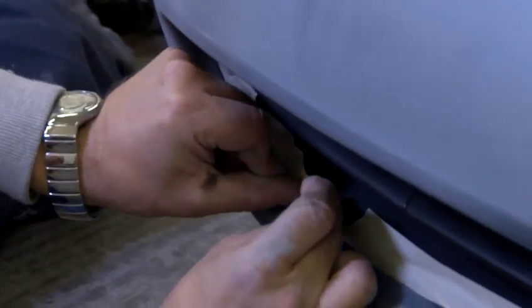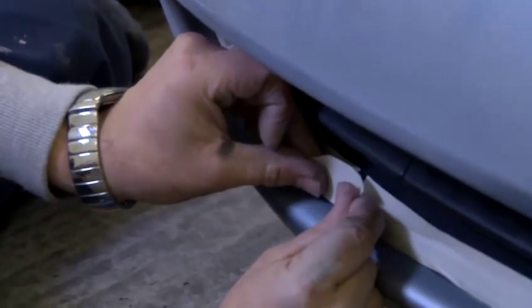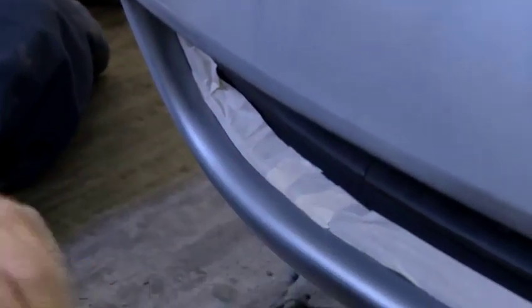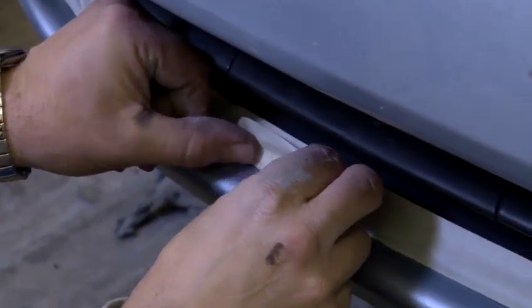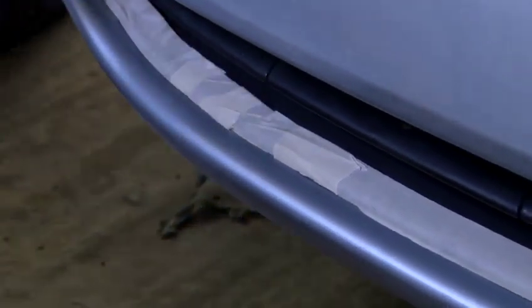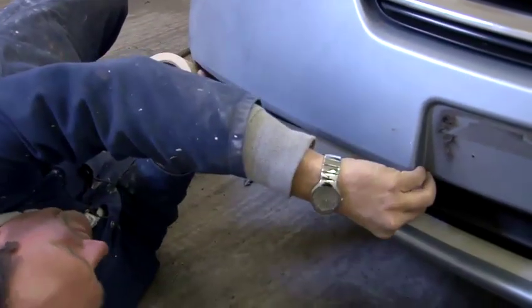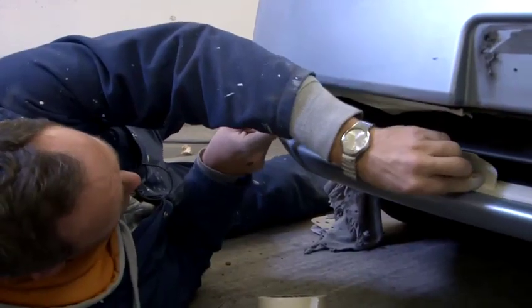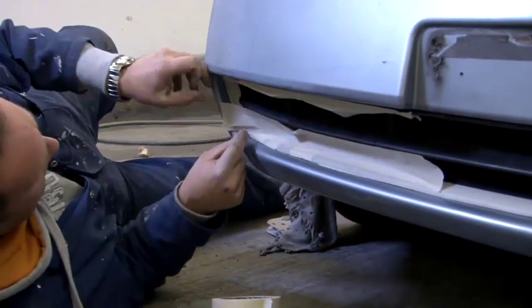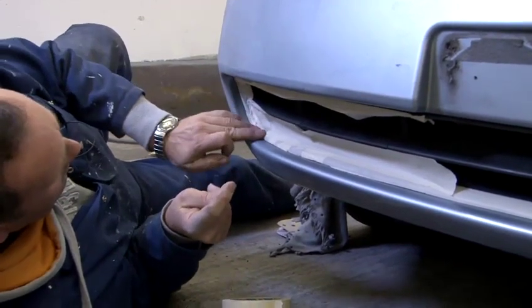And that corner that I've missed, I'll infill now. A little bit of a dodgy edge there. Infill the rest of it with the wider tape. If you don't mask up this inside area for priming or for painting, you will get so much overspray on there that it will take you hours to get off, in comparison with spending 5 minutes masking it up nicely.